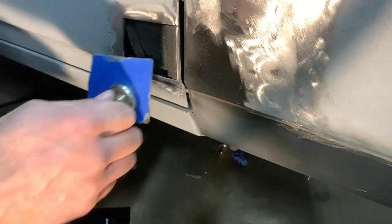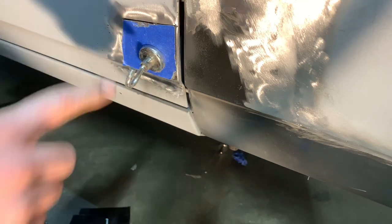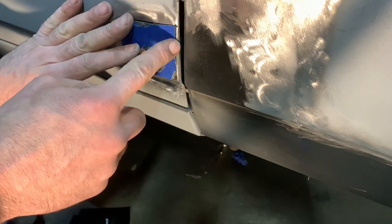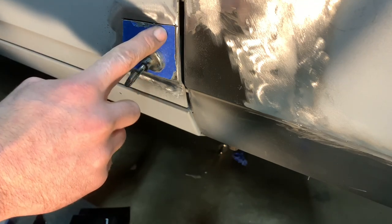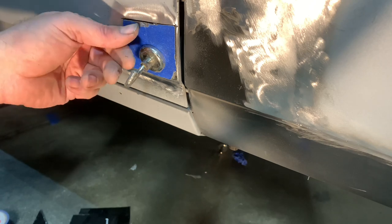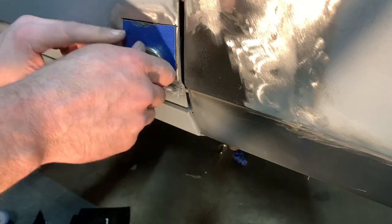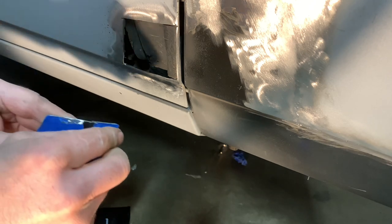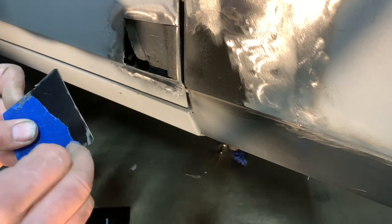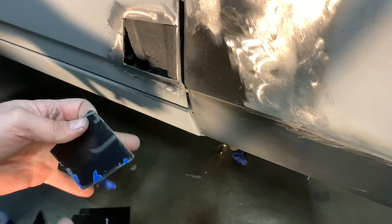One more last little check and I'd say it's going to work pretty good. The even cooler part: get your chunk of metal — this is left over from our fender repair — it has kind of a contour radius to it. Stick it right here on the piece of metal, and again it's not going to shift or move around. Just use the cutoff wheel to cut this thing out. Got it all cut out — you can see the tape holds up pretty good, trimmed all the way to the tape line. How well does it fit? Put it in here — pretty snug fit all the way around. The tape method works really nice. A radius corner is more ideal in the corners, but this method works for me and I'm going to say this is ready to tack weld into place.